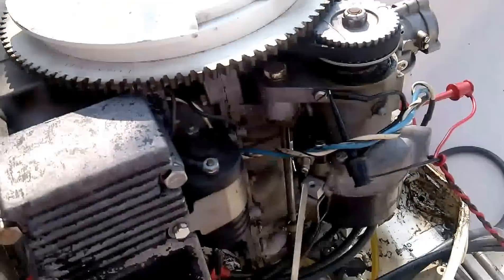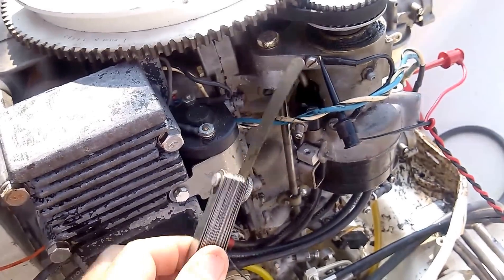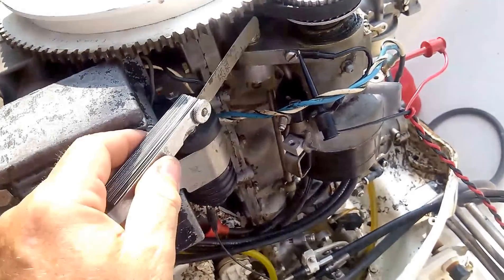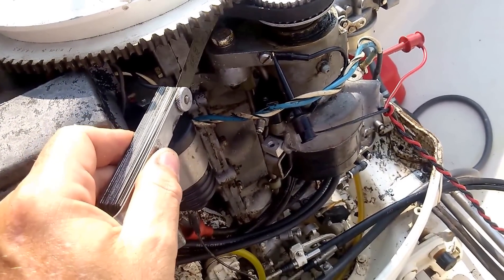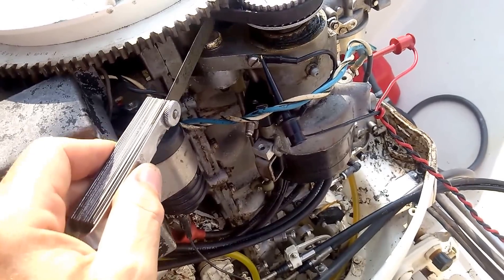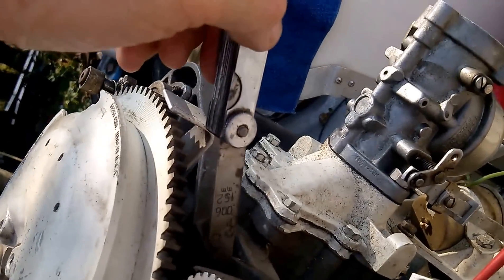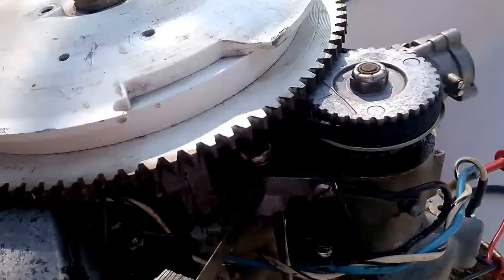So I'm going to climb up on my bucket. One other thing that has to be set right is the tension of this drive belt. The book says with an 0.006 feeler gauge, when you press in on the belt until it deflects — that's one pound of force — you should have a quarter inch of deflection. These belts don't run tight; they run just barely with the slack out of them. This is the pivot bolt, and over here on the other side is the bolt that swings on, so you loosen those up and tap it gently until you get the right clearance.